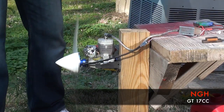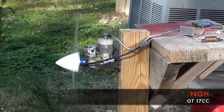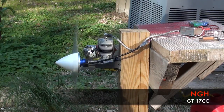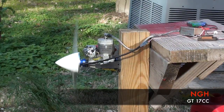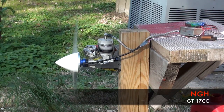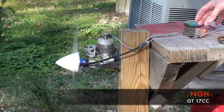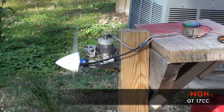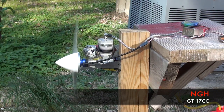25:1 or better. Use the recommended prop size that is specified in your manual. Keep the engine at a high idle between 3,000 and 3,500 RPMs. Run the engine for 15-minute increments, letting the engine cool between the increments. The engine should be fully broken in after 4 to 6 hours of runtime.